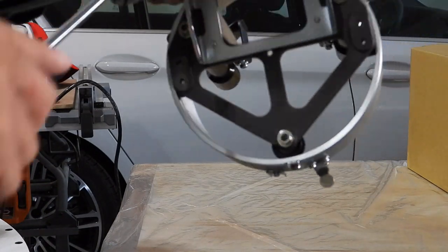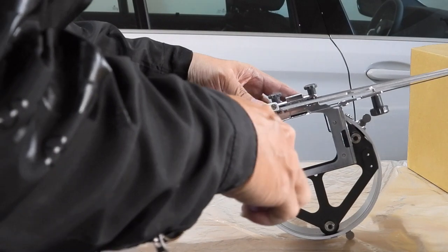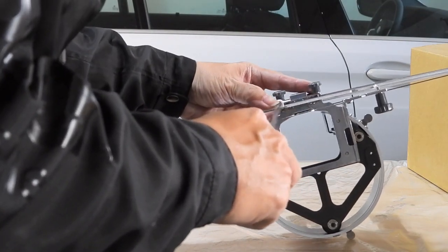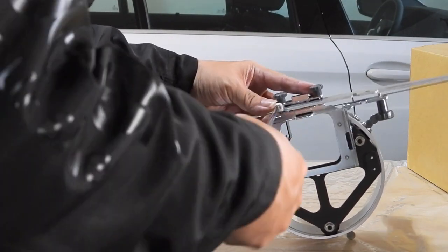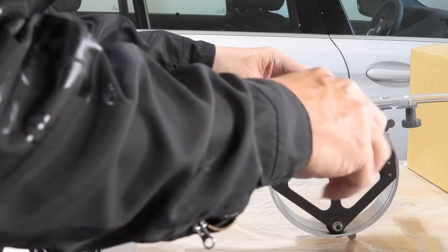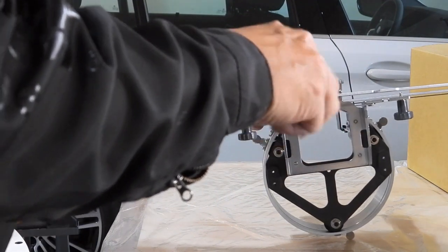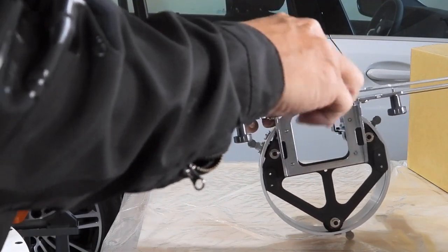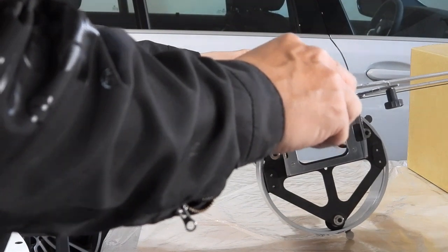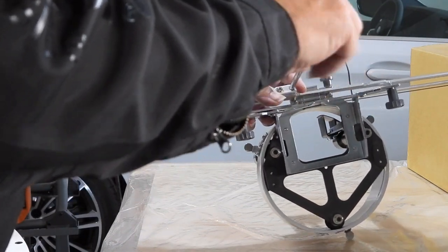The magnet will be detected by the green color sensor chip on the X-axis arm. Brother and Baby Lock multi-needle machines are twins. They all use this magnet position to detect which hoop is in use. You can find a similar magnet on many hoops or drivers. Also, many accessories are compatible with each other.